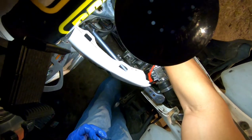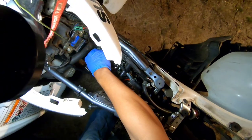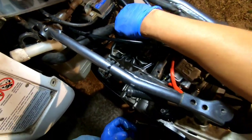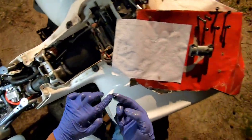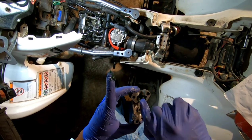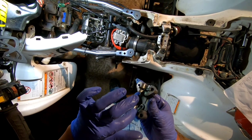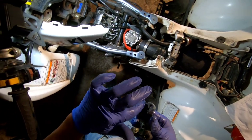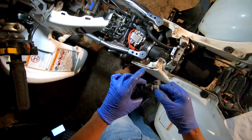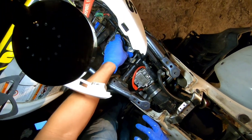I think I got it at 10 and 2, but you know, it will definitely tell when you go to try to crank it. Either it's going to fire right up or it's going to struggle trying to crank. If it struggles trying to crank, then you know you ain't got it. You know you got your timing off. The last time I put it together, I guess I was rushing so much, it was off because that joker was hard to crank. I said, man, I got to take it back apart. And I had to take it back apart. So we put them back on there.